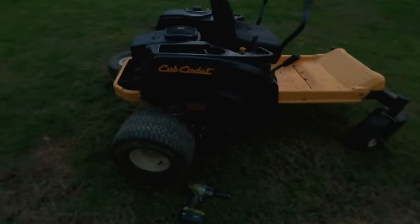So you can see where it's leaking around here. Now this is the valve cover I didn't open yet, but I'm hoping that all the oil I'm seeing is just resulting from this particular valve cover. So I did place an order. I got two new gaskets. I'm hoping this is the right one. It looks like it is. Yeah, that should be good. All right, let's get those installed.